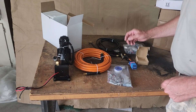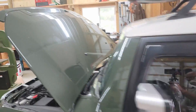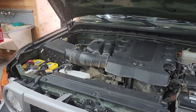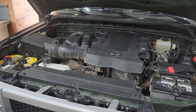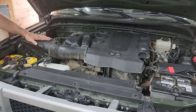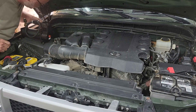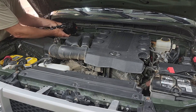Okay, let's go over to the FJ. I'm going to relocate the tripod and then we'll take this over and kind of test fit it. Ideally, I'd like to put it under the hood in the engine compartment. The reason for that is because I believe it will have some protection — you can see that when I hit puddles on the road there's some splash that happens up from the tires, and even though there's inner fenders and shrouding, it can't completely protect it. It's a lot cleaner than mounting it underneath the vehicle. This came with an inline fuse, but I think I'm probably going to end up taking up one of the spaces in my auxiliary fuse block.